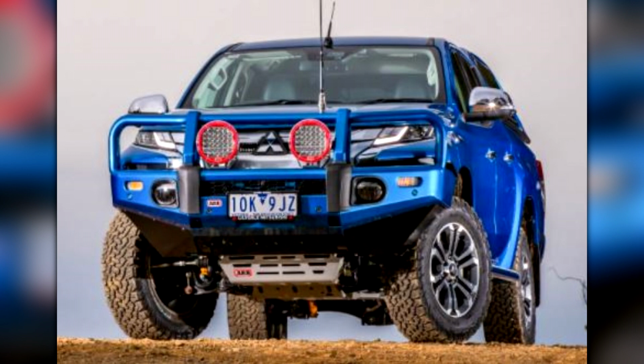Like the TJM bull bar, this bull bar also has excellent airflow into the engine bay, which mitigates any risk of overheating issues. It also comes with high lift jack points. I personally don't use a high lift jack because I don't have big tires and a big lift. I'm sure most of us who have an MR Triton would get away with using your average bottle jack to change a tire, but it depends what you're using the high lift jack for. Maybe you're using it more in a recovery situation, in which case it's more relevant to have those jack points.